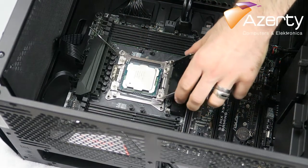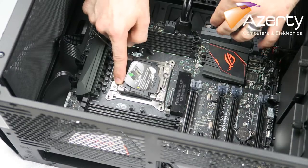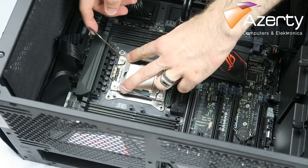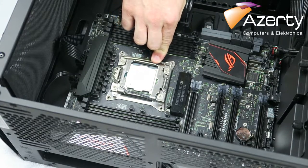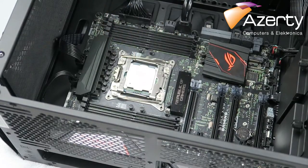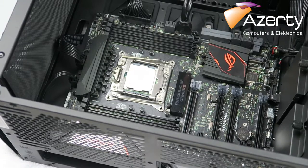That means it's good. You lay down the retaining clip, and you might think, what's that black thing? That'll jump off. That's really funny. If I now press it a little bit, bloop, there it comes. I'm a bit gentle, so I'll help it. There you go. This you put to the side. 2011 V3. First, you do this one again. Move it down completely. Make sure it hooks. That's good. Do the second one. There you go. You have installed successfully the 2011 V3 processor into its socket.